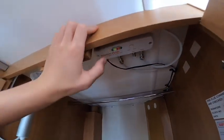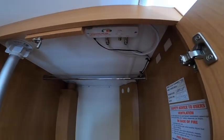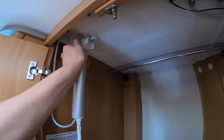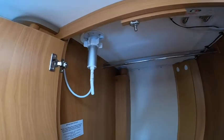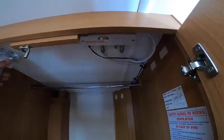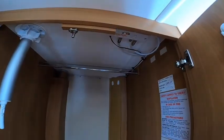In the wardrobe you've got your hanging rail, and you've also got your TV aerial and booster. The green light shows that the TV aerial has found a good enough signal. If it's orange, adjust the booster until you get the green light. If you're getting a red light and it's still not going green, you'll need to adjust the aerial — loosen the nut, push the stem of the aerial out and use the toggle on the bottom to direct it. Once it goes green you've got a strong enough signal. If your picture is still pixelated, try turning the booster down first. Leave it turned on as it'll go off with the control panel — it's a 12-volt TV booster.